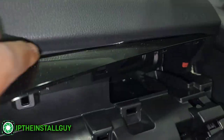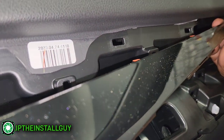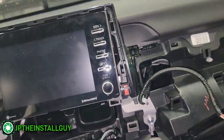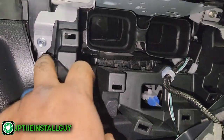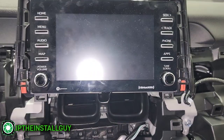All of this right here — please be very, very careful, this part is very delicate because it's very thin, and our passenger airbag is right there. Now it looks like we have one, two, three, four 10-millimeter bolts. When we take those out we should have the radio behind here.